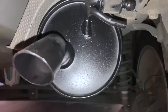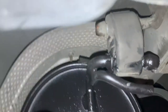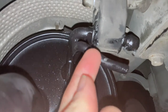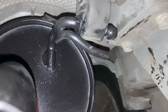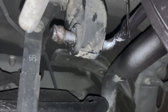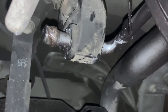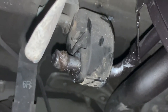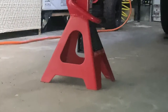I got the new muffler in. The trick with these little football exhaust hangers is to put Vaseline all over the rod and smash some in the hole. That way it'll go in and install easily. That's why it looks all greasy up here — you just want to cover that rod with some kind of lubricant, soap or Vaseline, whatever you want, to allow it to slide into that little rubber football, whatever that exhaust hanger is called.